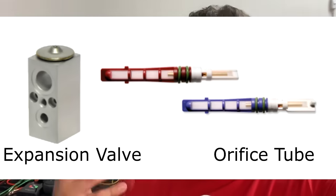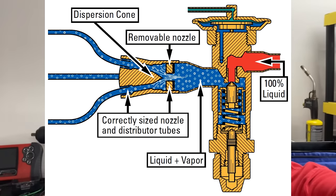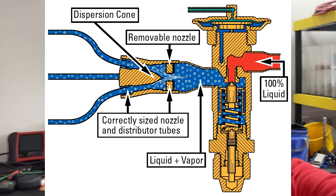When this liquid gets discharged from the AC compressor, it's actually very hot. The way we turn this hot liquid refrigerant into a cold gas is through something called an expansion valve or an orifice tube, which works much the same way as an aerosol spray can. Inside the can, we have a compressed liquid — you can feel it if you shake it. But when you shoot it out through that tiny little orifice on the nozzle, it comes out as a cold atomized spray. The orifice tube in your AC system works exactly the same way, forcing the hot liquid refrigerant through a tiny orifice, where it turns into a freezing cold gas.